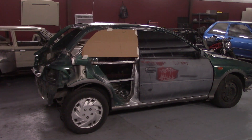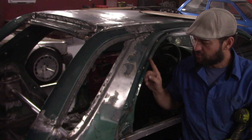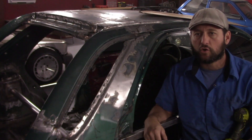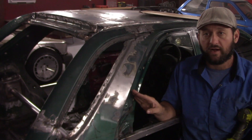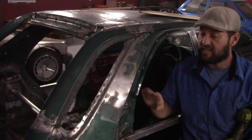I think the proportions look pretty good. So I'm going to start cutting metal to move the existing window opening to meet this new template. To move this C-pillar, I'm going to drill out some of the spot welds and pull the skin off and have a look at the structural pieces underneath before I start cutting. I know that's unusual for me to not just get out an angle grinder, but some things do need a little bit of a delicate touch.